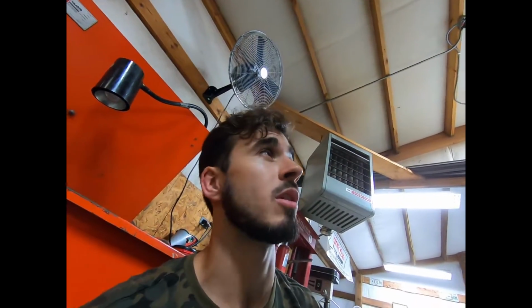All right guys, so like I said, not really a lot of videos out there on this thing. So I did go ahead and pull all these T15s just like we talked about. However, there are 4 10mm bolts on the ZR2. 2 of them are pretty obvious, like I talked about earlier. You can see them right there. Now, if you're wondering where the heck's the other 2, well, right there it is. See up in here? That little bolt right there.